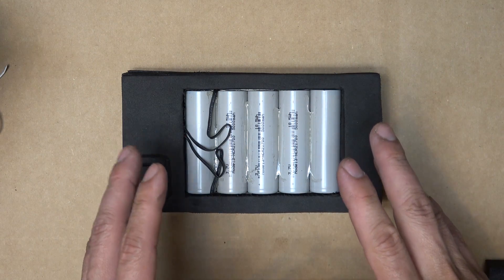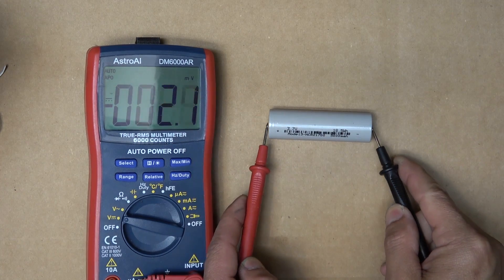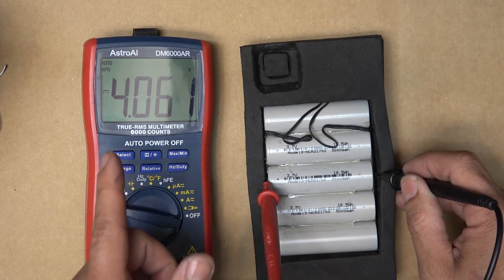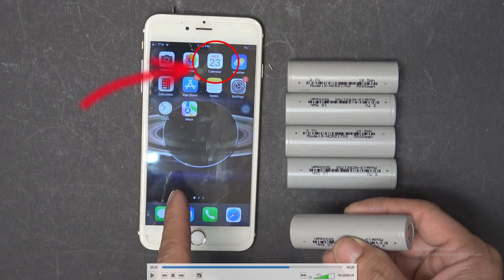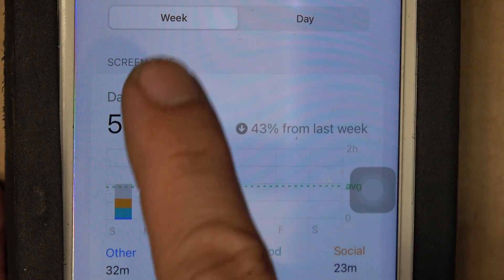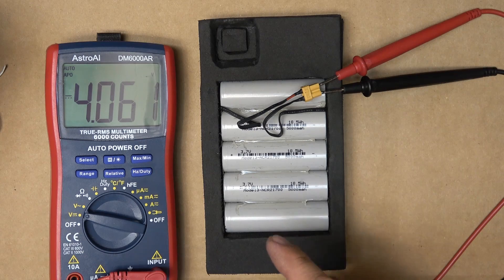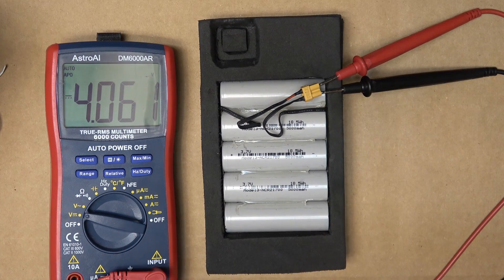I've been using the phone for about one week now, and here's a little update. The battery pack started at about 4.13 volts and right now it is 4.06 volts. If 4.13 volts is 100%, then 4.06 volts is still around 90% capacity. I installed the battery on the 23rd and today it's March 30th. My average screen time is about 55 minutes per day. So within 7 days under normal usage, I've only used up about 10% of the battery. If the usage has a linear relationship, it will take about 70 days to use 100% of the battery — that's over two months on a single charge. That's crazy.